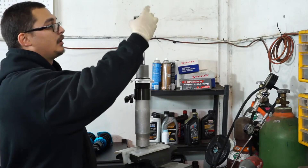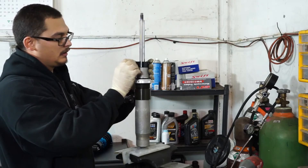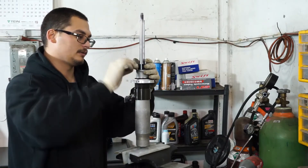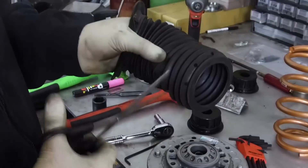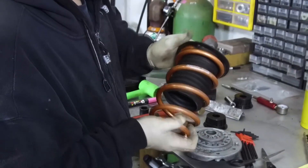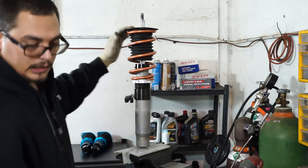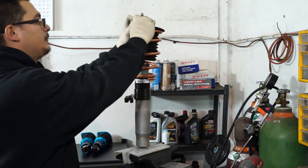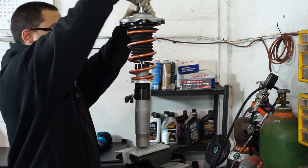Next up, we'll be replacing the bump cap. The stock bump cap that was previously removed will be replaced with our aluminum one. Make sure to tighten down the allen so that the bump stop does not slip off and cause damage to the strut shaft. You'll have to trim off five ribbed sections from your OEM dust boot to allow clearance for the Pro-S kit. You can now install the front spring and dust boot together. With that all said and done, you can install the bump stop. Make sure the thicker portion is on top and the thinner portion is on the bottom. Last but not least, secure the OEM top-out with its respective nut on the top of the shock.